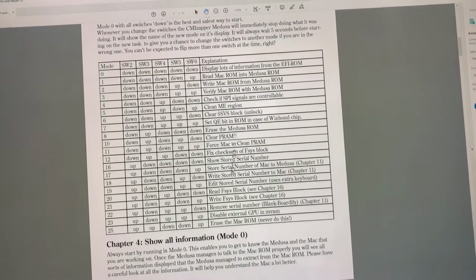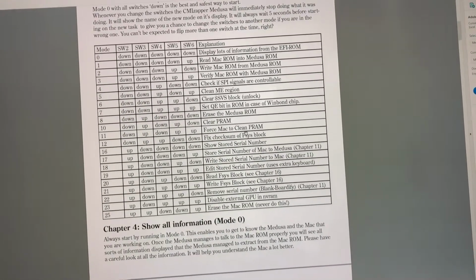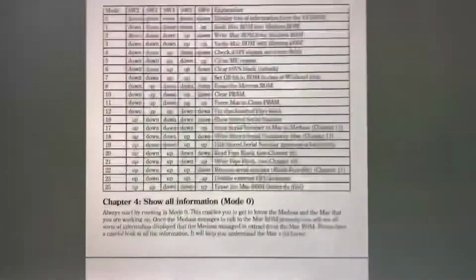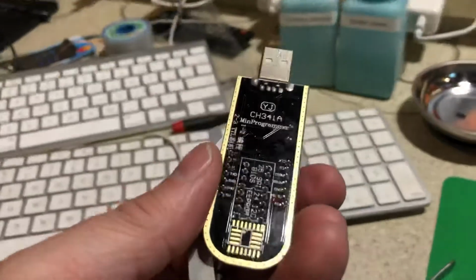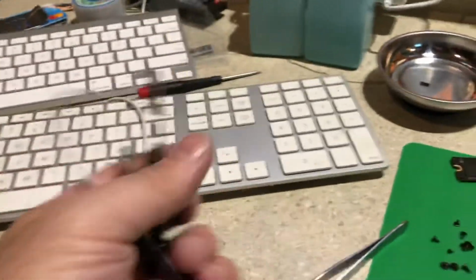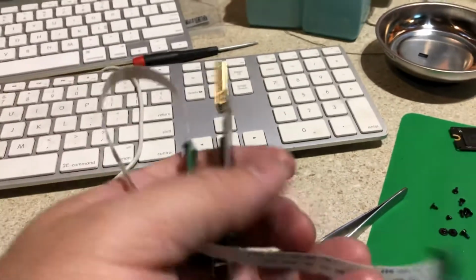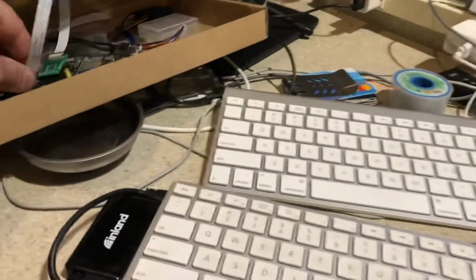They're working on that. The checksum of the FSYS block is to make sure your serial number, even though we change it, gets automatically corrected during this process, which this programmer does, as opposed to a conventional programmer, which is what a lot of people use because they're less expensive. You can buy these on eBay. To buy them with the special adapters that work on Apples, you're going to spend maybe $80 to $100. You can buy just the programmer itself without the fancy Apple plugs for 10 bucks. So somebody's getting rich making these little plugs.